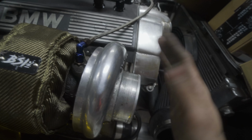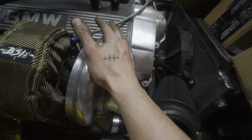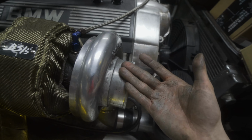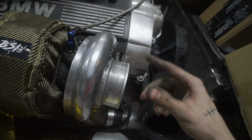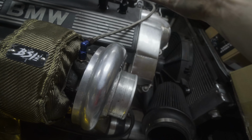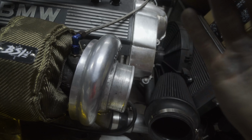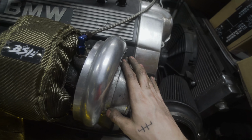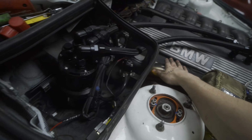Another thing I've heard is that when you're pulling it back into here, since this is effectively your intake for your car now on a turbo car, any oil vapors can cause pre-detonation because it mixes with your air, causing maybe a bad air-fuel ratio. It's just dirty air. So I'm eliminating all of that and doing it vacuum through the exhaust. So yeah, that was my long-winded explanation.